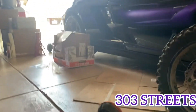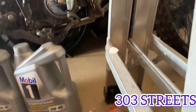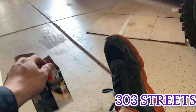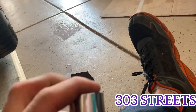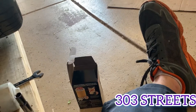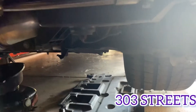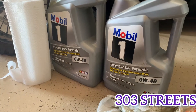The filter I'm going to use is a K&N. Here's the box — if you go to the store and want to get this one, this is what I'm using, just a performance filter. I really like K&N all around. The best part is it comes with a little socket or wrench so you can tighten and untighten it. Here's the socket I'm using: one inch, it's a Craftsman — it fits on there nice. You're going to need six quarts of 0W-40 full synthetic — that's what I like to use.